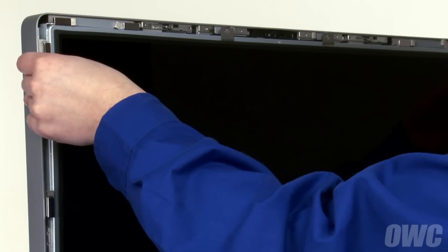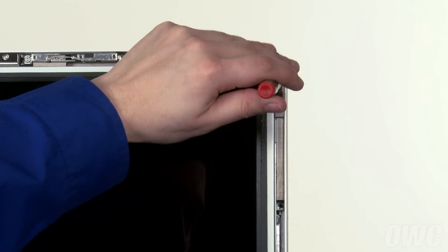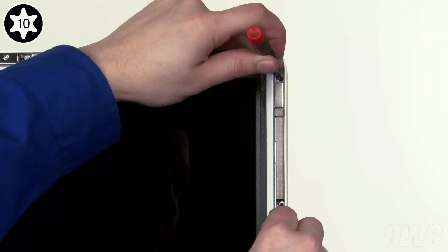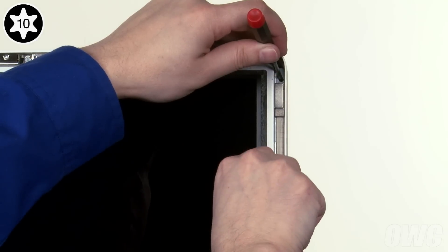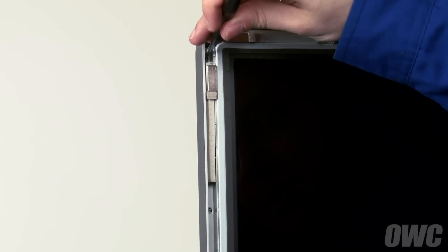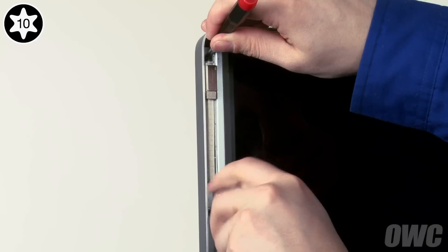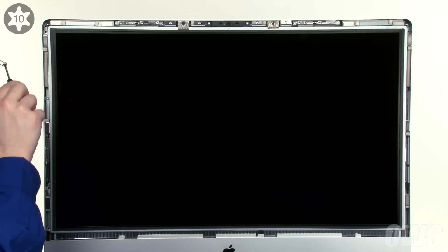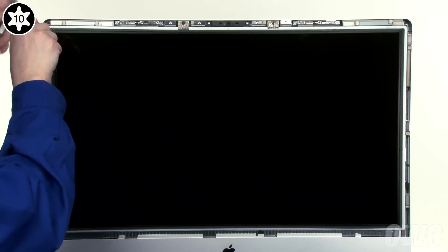You can now lean the display back so it lays flat. Take a narrow screwdriver and slide it through the top screw hole in the display and into the hole in the iMac. You can then use the screwdriver to lift the screen up and down to align the second screw holes, and insert a screw so that the screen won't fall. Repeat the process on the other side. Finally, replace the remaining screws and tighten them all down. Use your tweezers if the magnets make installing the screws difficult.